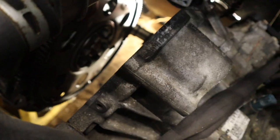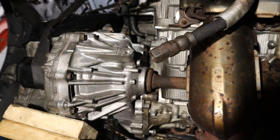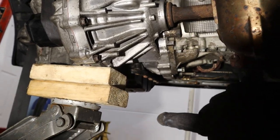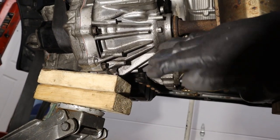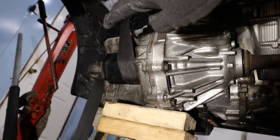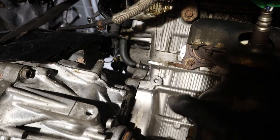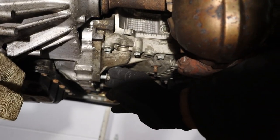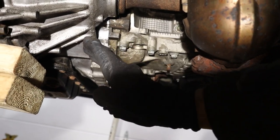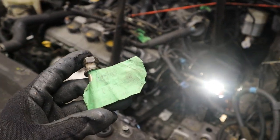I tried to line up the axle first, using my jack underneath to kind of get it in place. That was a lot of work, but I tricked my brother into helping me. The transmission is fully aligned — I had to use two jacks, one on the front and one on the back, because it had to rotate as well as align. I also used the crane to bring it up to the correct level and a pry bar against the frame rail to chuck it into position. There are dowel pins to line up as well. Once I caught the two alignment points I used a screwdriver to close the last half-inch gap. Make sure you push the torque converter all the way in. Now I am going around to add all the bell housing bolts — they were different lengths so make sure you label them.